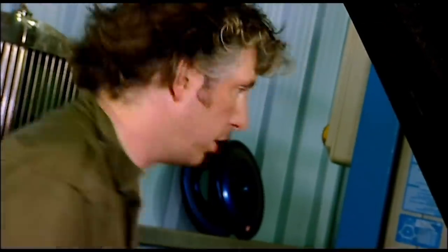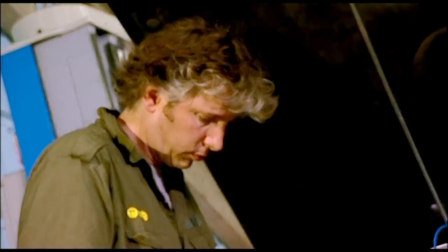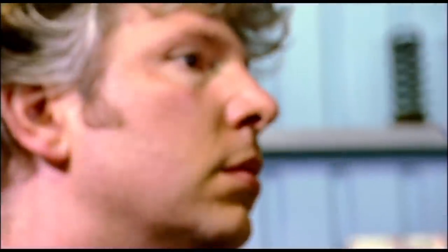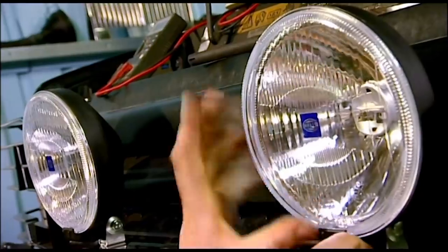If I pull the high beams on we should hear that relay click — brilliant, so that works nicely. The next thing is to connect the high current relay side: one side has to go through a fuse to the battery — very important to have that extra protection — and then the other side of the relay goes down to the spotlights themselves. I needed to check the operation of the lights as I went so I didn't disconnect the battery for this job. If I was fitting a new starter motor or another major electrical part then of course I would have. If you're in any doubt always go for the safest option. At last I crimp on the connectors which will attach to the spot lamps and I'm pretty much done.